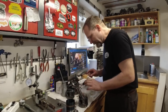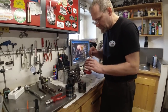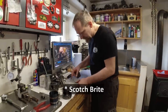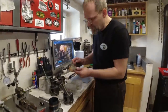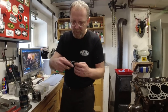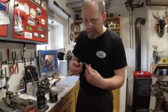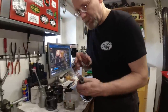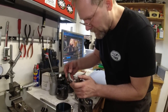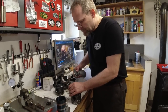Now we're gonna install the bearing into the connecting rod, and the way we do that is also with a very light coat of ATF. I got these previously cleaned with emery cloth. Here I've got my bearings labeled U for upper — it's the upper bearing. They have a coating on the back, so we'll take that off with emery cloth. You don't want to touch the other side. Now the bearing is all clean, and I'm gonna orient the marking on the bearing to the marking on the connecting rod, just so that I have a direction in case something goes wrong. I'll give it a really light oil.